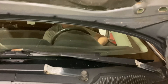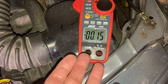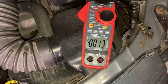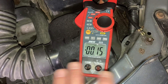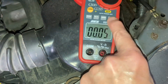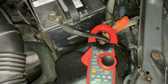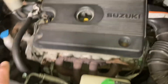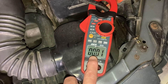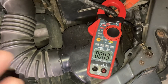My son is inside helping me turn on the loads at my request. The car is somewhat woken up — it's actually drawing 150 milliamps at the moment. The way we're going to monitor each load is: whatever the nominal draw is at the moment, we zero that out. So now any loads we turn on — I don't need to know where the wiring is, I don't care where it runs through the fuse block or elsewhere — I can monitor every single milliamp draw going to any electrical load on the car right from this point.